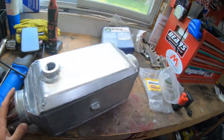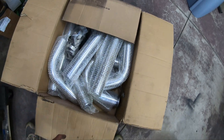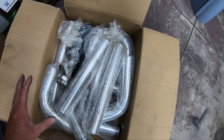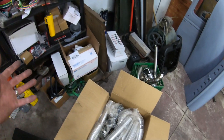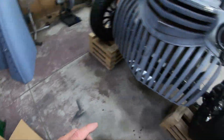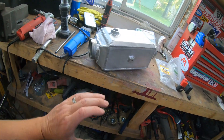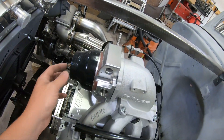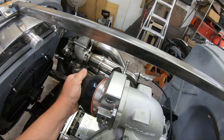That is what we're going to use. It's got a 3.5-inch inlet and outlet, so we'll have to reduce that down. I have extra pipe left over from when I boosted the Le Mans, so we're going to try to save a little money by reusing that stuff. I need 2.5-inch coming out of each turbo, and we're going to Y that together into a 3-inch. Then we expand up to the 3.5-inch intercooler inlet, come out the other side, and reduce back down to 3-inch heading to the throttle body. We'll call it a grower - it gets bigger.